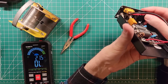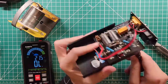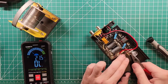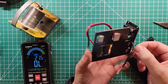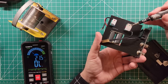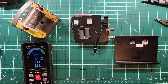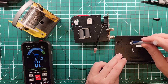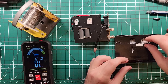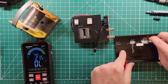Interesting - there's some stuff underneath the circuit board. It's a temperature probe for the fan. There's nothing accessible from the bottom, so I could have done all of this from the top. You can see there is a plastic insulation bit there, and another plastic insulation bit there. I'm going to put some fresh heat sink compound down - this stuff does like to get everywhere. Yes, that is a lot, but that's okay because I have the technology to clean it up.